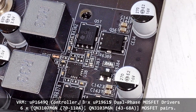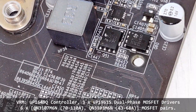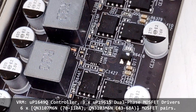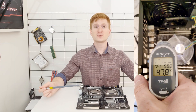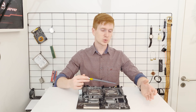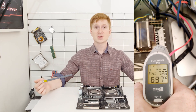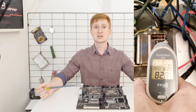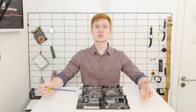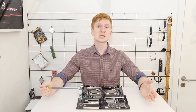I tested with two E5-2690 V3 CPUs with Turbo Boost unlocked and -70/-50/-50 mV voltage reduction. The stress test used AIDA64 and ran for about one hour. On the CPU 1 side, where the VRM had better airflow and cooling, the maximum temperature registered was about 65°C — a very good result. On the other side, where the VRM was cooled less effectively and the CPU cooler was blowing hot air straight under the VRM zone, the VRM heated up to 85°C. Ideally you should keep VRM temperatures under 70°C for constant load, and 85°C is not the safest temperature.